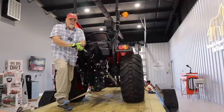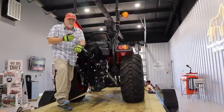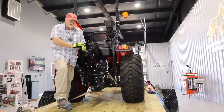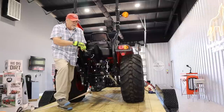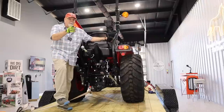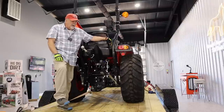If they're not helping, increase the gain on your little box on the dash. If it's helping too much, you can look in your rear view and you literally will see smoke coming out of the tires because they're skidding, so lighten up on it. You'll get the feeling. You want it to help, but not overpower. The truck is still the main way to brake, through the brakes and the transmission downshifting. But these need to be adjusted properly, and you'll get the hang of that. I can do it on the way out of the parking lot here at work. I can adjust my gain and be righteous with it.